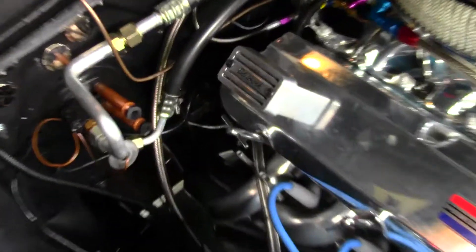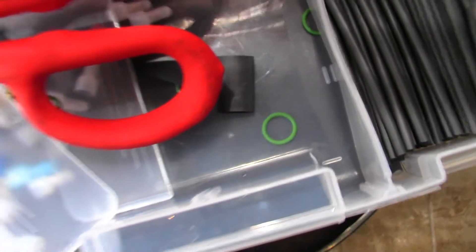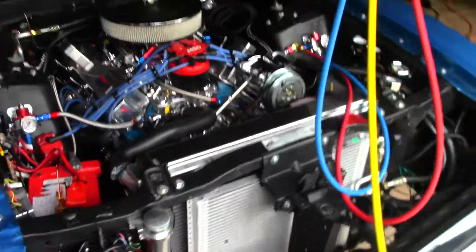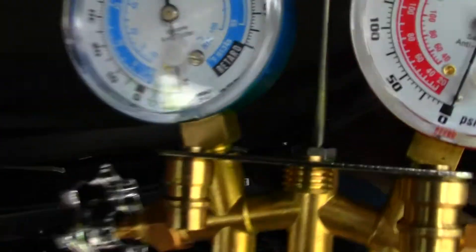So what I did — I have an assortment of O-rings and I reattached the fitting. Here's my problem right here: this fitting that goes onto the expansion valve right there. That L-shaped fitting is my problem area and it spewed leak dye all over the place the last two times I had a charge on this thing. So I replaced the O-ring again, cleaned up the receiver area where that O-ring actually goes. I did put a little bit of thread sealer on the threads of that brass fitting — just a tiny bit, really just to lubricate the thread as it's going on, not really to stop a leak. I'm not by any means band-aiding anything together; I'm trying to simply isolate this leak and make sure it's not leaking anywhere else.